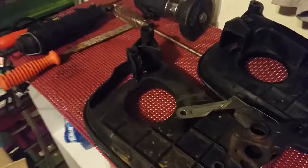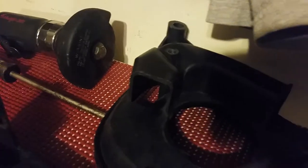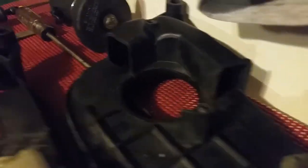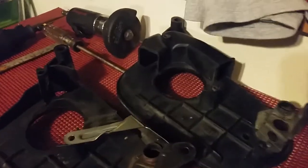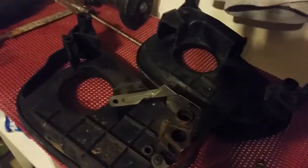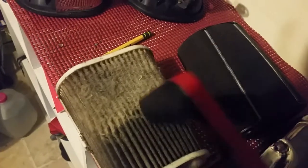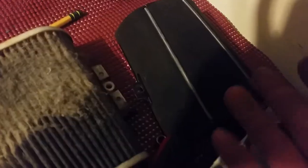Basically what I ended up with is a wide open air filter assembly that can suck in the same volume going out, which is very important. The original airbox has awful airflow — they don't make an aftermarket air filter box for these. I like that it looks factory. I went from the pleated paper filter to the older style foam filter, which flows more air and still cleans well. I haven't had any issues with those air filters.